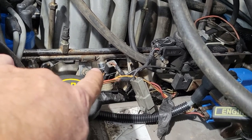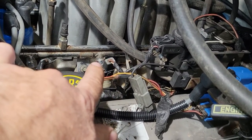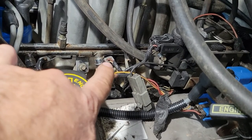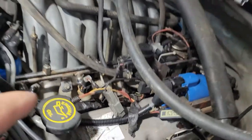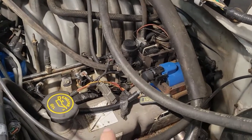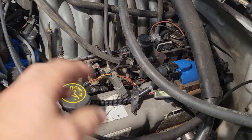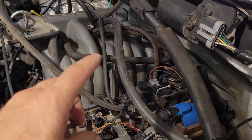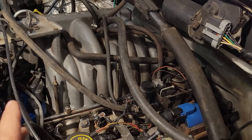And when I turned the ignition key on to check for leaks, apparently I didn't wait long enough for the leak to happen. So when I first test fired this motor, it ran for about 15 seconds before it ignited. So I ended up catching all of this on fire, unfortunately, and it burned up. Luckily, the wiring's all protected by the wrap that it had on it. So the wire wrap protected the wire. It did its job. But all the little poly vacuum lines that ran around them, red ones and all that, those things melted instantly. And they were cracked and junk anyway.